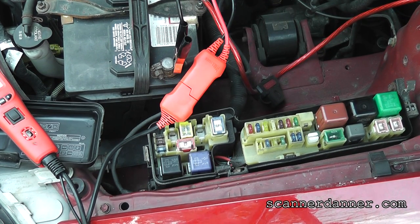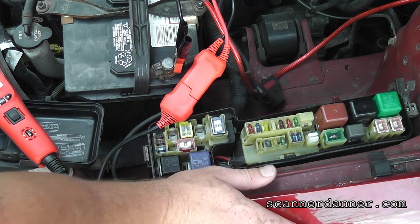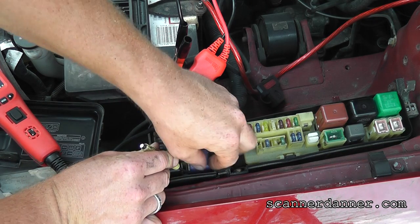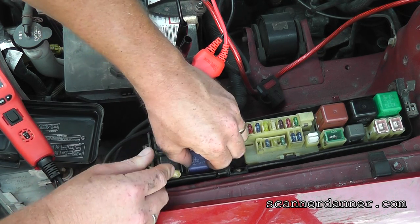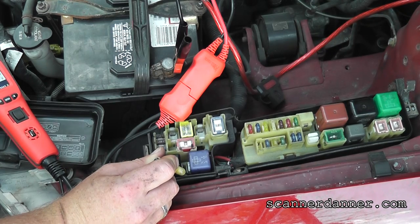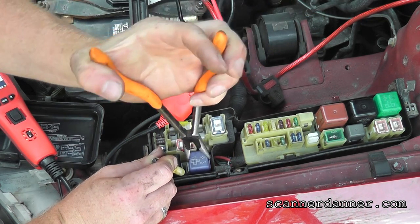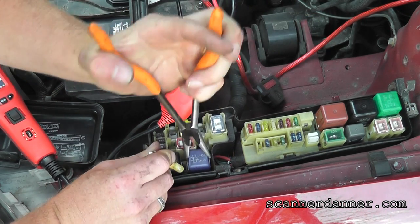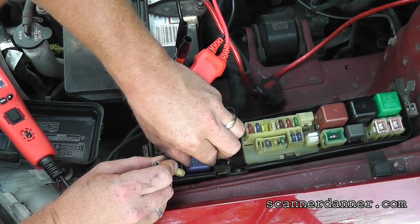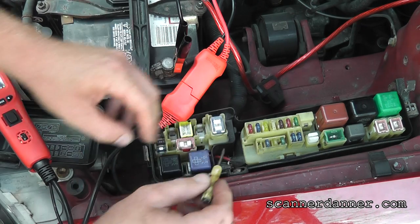Yeah, the other thing here too, Jake, is our voltage drop that we were getting was telling me that we had a decent amount of current flow here. This might dictate my next move too. I want to do a current measurement. I'm not familiar enough with the power probe to know why I was reading 10 volts instead of 12. And I think that's because of current flow. This is stuff you have no idea what I'm talking about. I'm kind of talking to my viewers here.